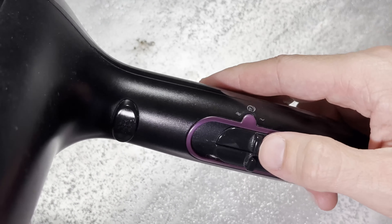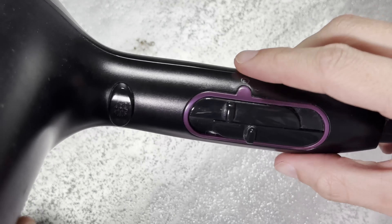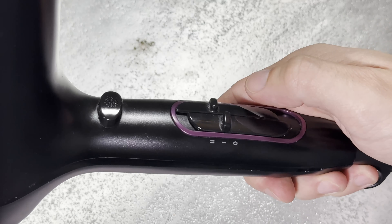To fix the mirror you only need a hairdryer. Please, please, please only use a hairdryer — not a heat gun. Otherwise you will melt and destroy your camera. To heat up the glue you don't need a lot of heat and you certainly don't want to destroy the electronic components of your camera.